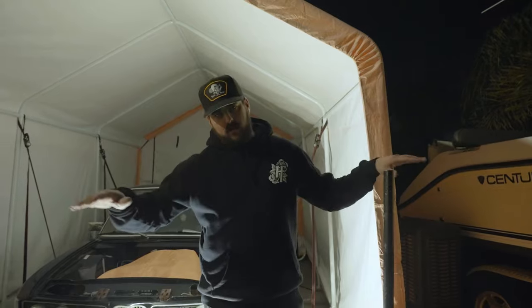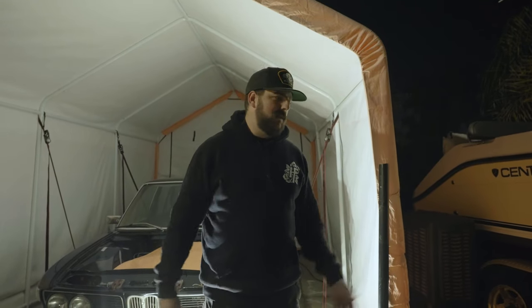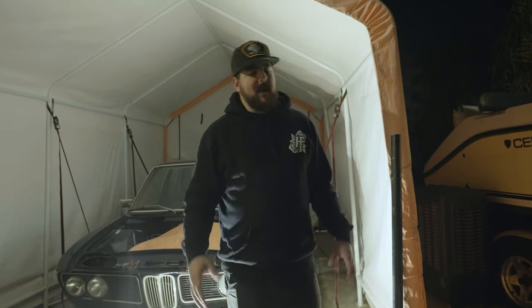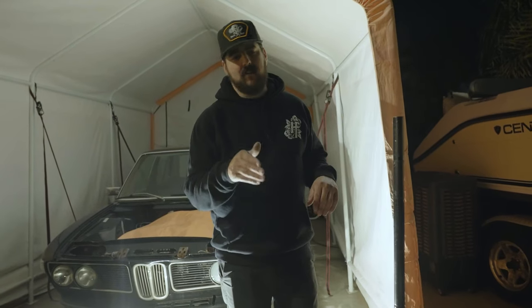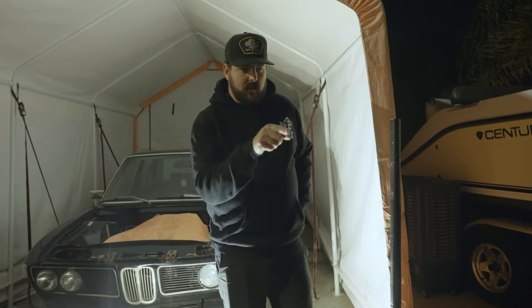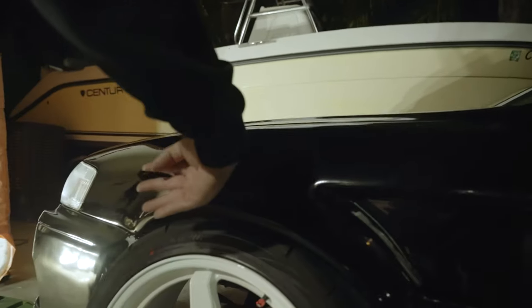It does not cross the board is how you do it. That's why when you see somebody say it's a half inch towed out or a quarter inch towed in, that measurement goes universal, but how you make the adjustment depends on where your rack is. With this one, I can see that this tire is pointed out in this direction. So on the rear rack system, I'll just pull it out and it'll force the front of the wheel to tow in.